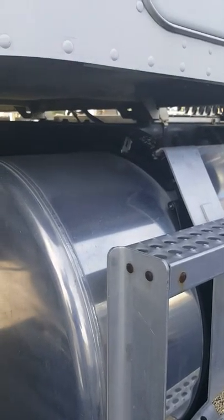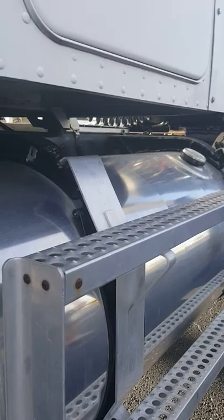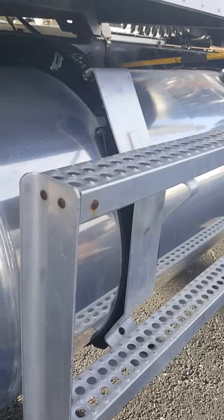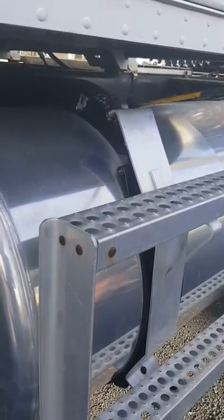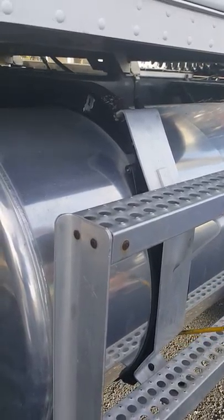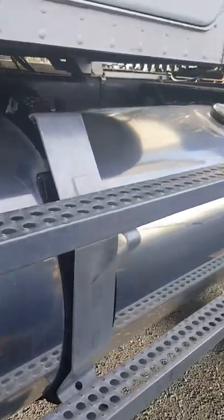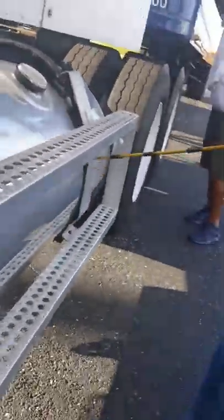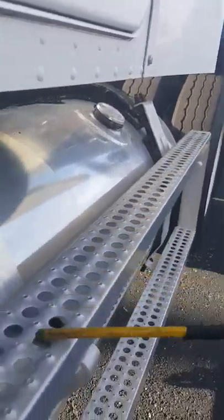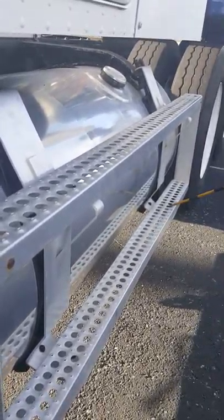Coming to my fuel tank — my fuel tank mounting is securely mounted to the frame. The straps that go around my fuel tank are securely fastened and tight, they're not missing any nuts or bolts, no rust trails that would indicate anything was loose, and the rubber in between my straps that protect my tank from rubbing and chafing is in place and in good working order.